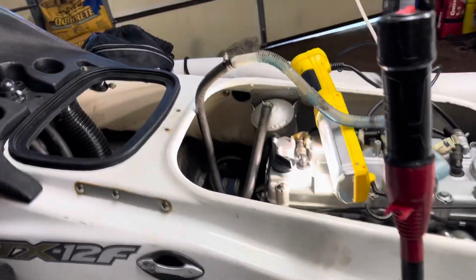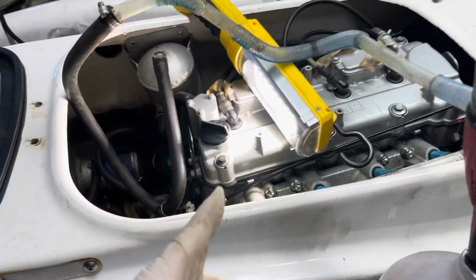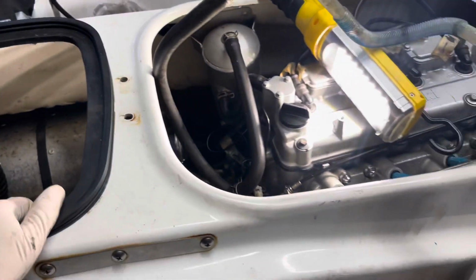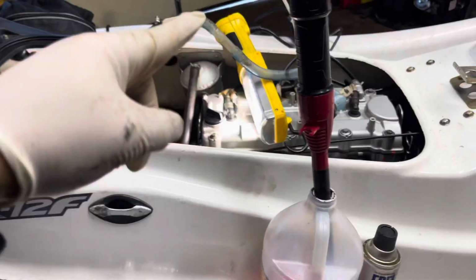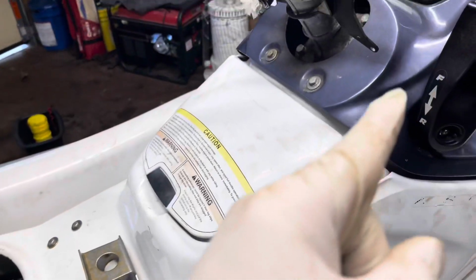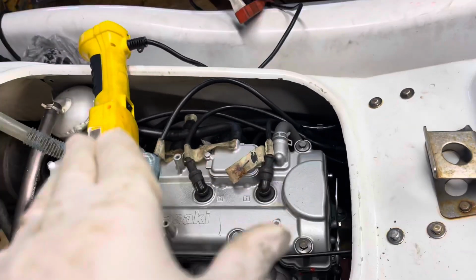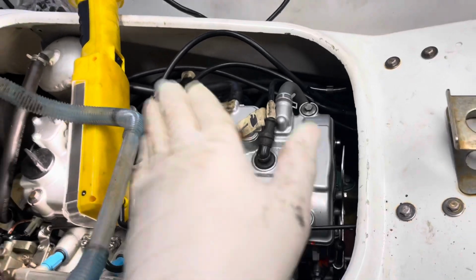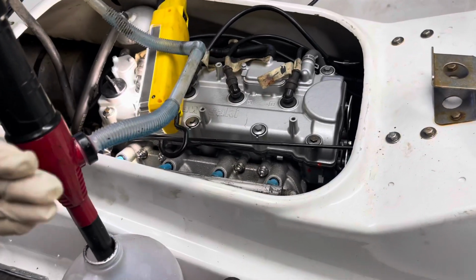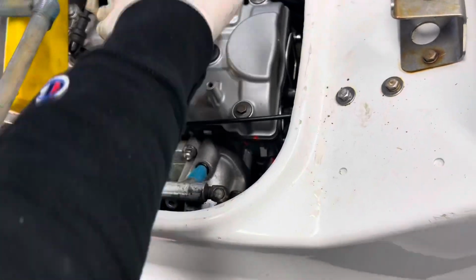Alrighty, as a quick precautionary measure, I found the hose that goes straight to the cooling jacket to the motor. Pulled it out from the bottom of the muffler, and I'm gonna actually run more antifreeze onto this side, because as you remember, that side fed the header, and I'm assuming most of the fluid went down. This side, at least I can be assured that the coolant will go through the intake or the block and then out to that side.